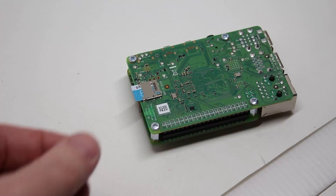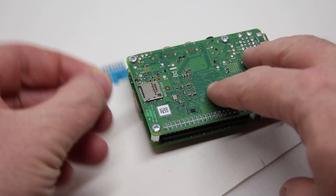Hello there, my name is Gary Sims and this is Gary Explains. Did you know it's possible to boot a Raspberry Pi off another Raspberry Pi, and the client Raspberry Pi needs no SD card, no attached storage — it runs everything over the network, talking to the second Raspberry Pi, including the home directories and all of the space it needs for Linux. Absolutely brilliant technology. Today I'm going to go through a tutorial on how to set that up.